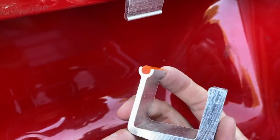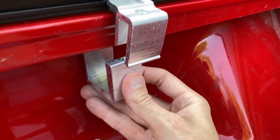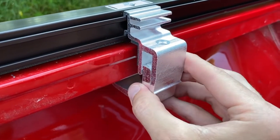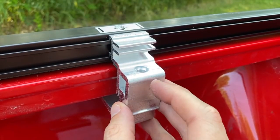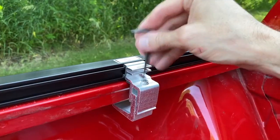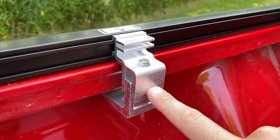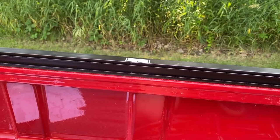That padding protects your paint. Grab the bottom mount — the orange little rubber padding protects your paint on the bottom side. There's your threaded bolt hole; install this properly, it slides right up in place and only goes as far up as your truck bed will allow. Grab that bolt, feed it in, and screw it tight. Important recommendation: that is a steel bolt going into an aluminum thread — do not over-tighten it. Clamp number one is secured.